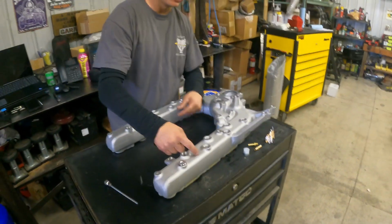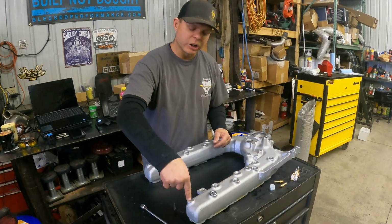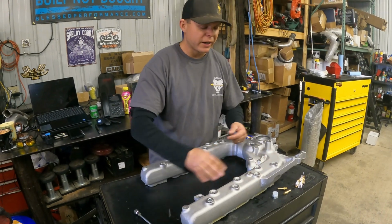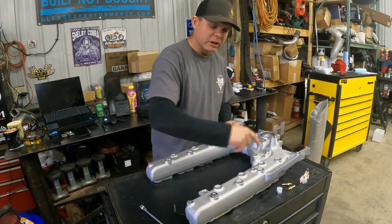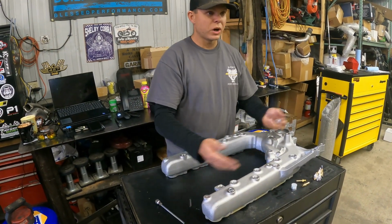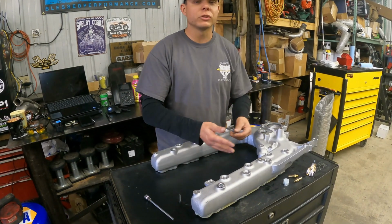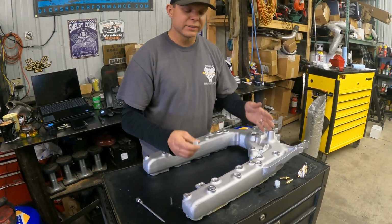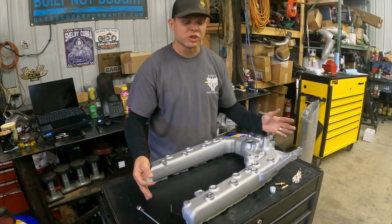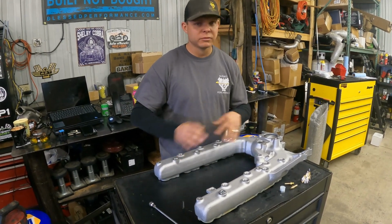Now, effectively, you got rid of all of those, if you remember from the factory intake, all those guides that go through the manifold essentially to help guide the bolt through. By getting rid of all of that, now it's a straight shot of air from here back to here instead of a zigzag pattern, okay? Which creates pressure, creates restriction, which creates heat and restricts airflow to the back cylinders. So like I said, 2% difference from front to back on this, 46% increase in airflow in general. Adds 25 horsepower to your truck, to the rear wheels, on a stock truck.